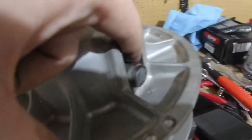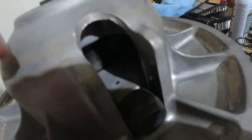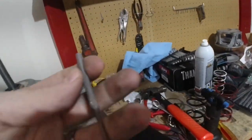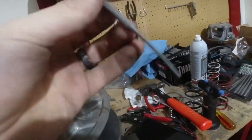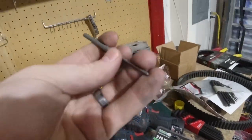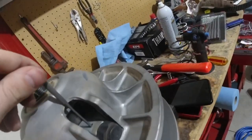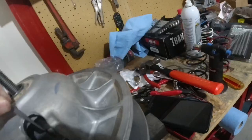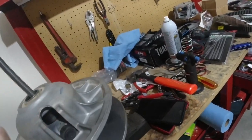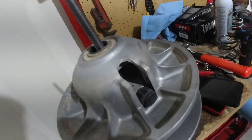You can see there's a huge flat spot right on top of this roller. To take these rollers out, there's a little pin that runs right through here and comes out the bottom side. You use a punch here — this is actually part of a gun maintenance kit, I grabbed this on Amazon for about nine bucks. You barely have room to get in here — it's at a slight angle, but just put it in and push that through with your hammer and the roller should slide right out. Then we'll put the new roller on, push it back in, and push the pin back through as well.